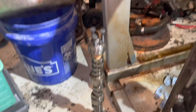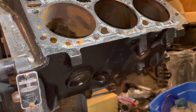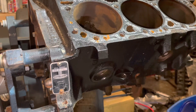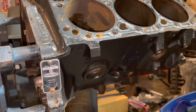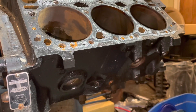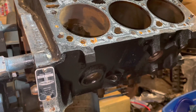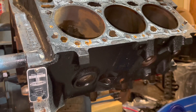I'll one day find out what this cam part number is and check the grind against the Vortec V8 grind to see if it's the same — just two less cylinders. So the camshaft is going to be different. I'm going to use the marine camshaft that came out of this engine when I rebuild it. But I'm going to talk to the customer about trying to use Vortec heads. He bought another core engine — a truck motor — for $50 on the internet. It's a Vortec engine, so it's got Vortec cylinder heads. Now he's got a choice of two blocks and two sets of cylinder heads. If we can find an inexpensive Vortec intake, he can switch to the Vortec heads.